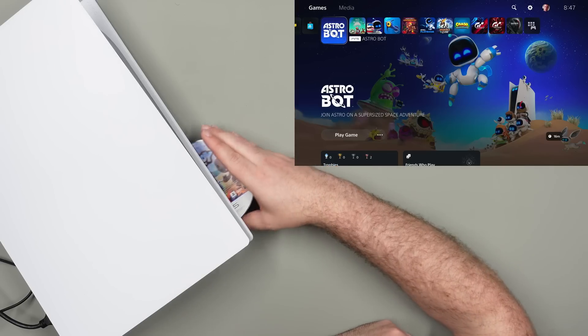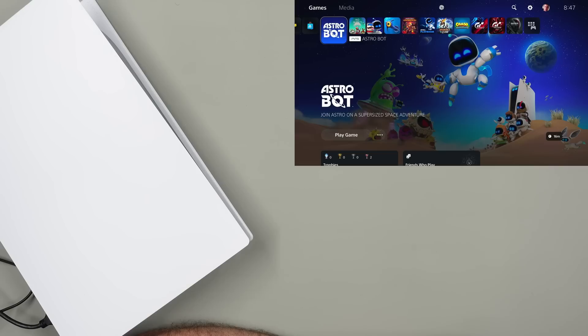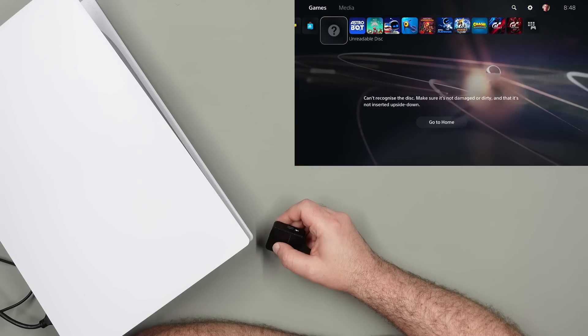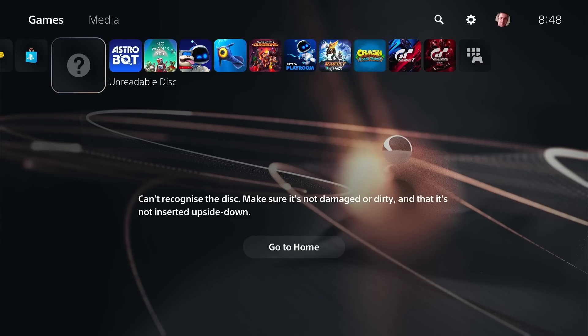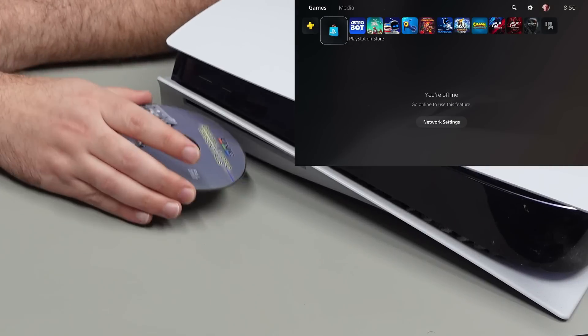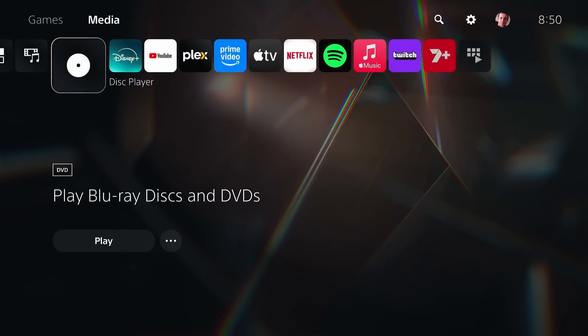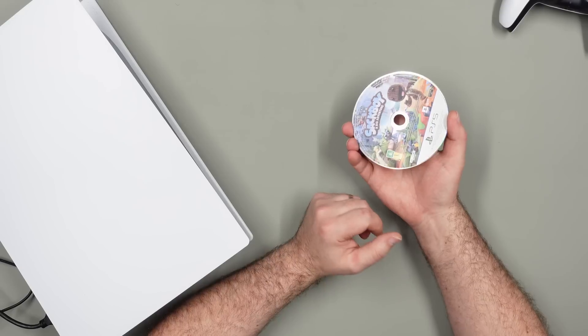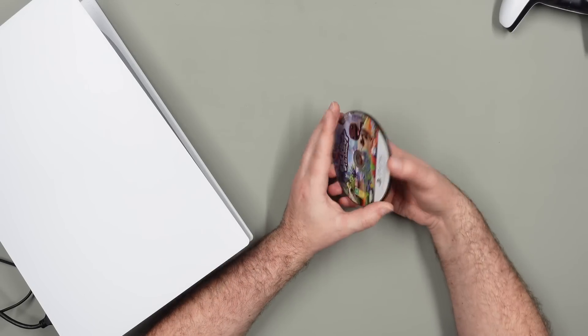If we just throw a game in, it'll take the disc just fine. But all we get is the little disc icon on the screen, and the drive just makes a bunch of fun noises for about 30 seconds, then we get 'can't recognize disc.' The same thing happens with a CD. Interestingly, if I throw a DVD in here it reads it perfectly fine with no skipping. So that is kind of odd — if it was a dirty laser I would have expected all discs not to work, but it seems DVDs do while audio CDs and Blu-rays do not.